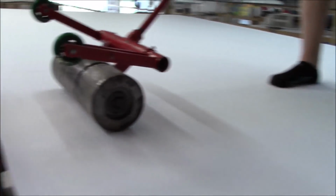We're working there. So on the roof, we got the roof going down. That's what we're doing right here. That's the membrane, the back side of it. So we're just balancing the roof out left to right. And once we do that, we're gonna glue it down. All right, we got the roof rolled out. It's all glued. You see all the glue under it, actually. We got our protector strips on here. So now we already did that other side. We just rolled this other side here and got busy.